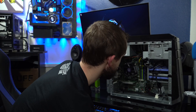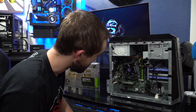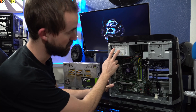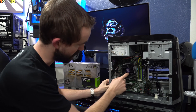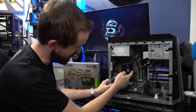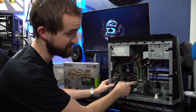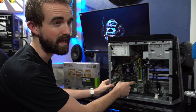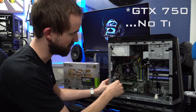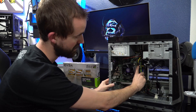Don't you love seeing the inside of a pre-built system? Just to go through the original specs: you have the 250 watt power supply up here, an i5-6400 under this unique stock CPU cooler, this is the GTX 750 Ti — you can double-check that in the description — and this is an 8 gigabyte stick of DDR4.